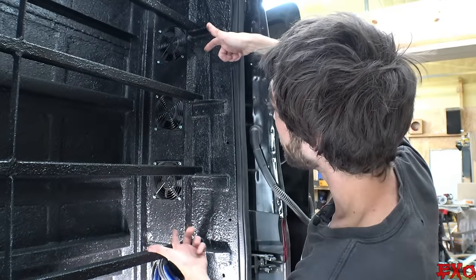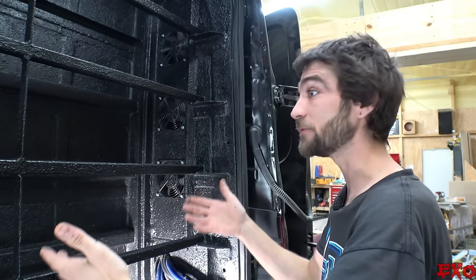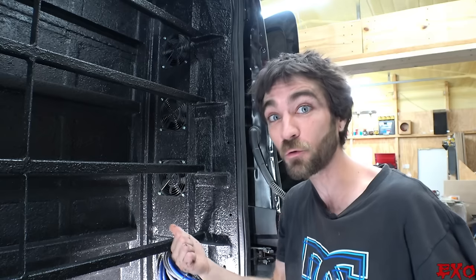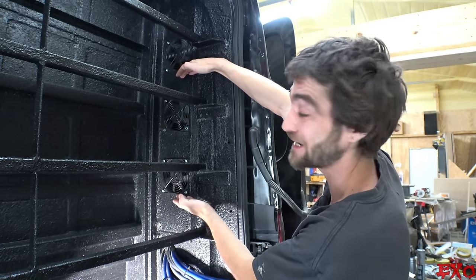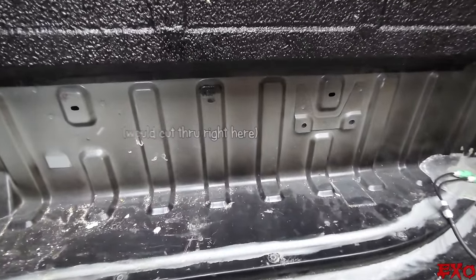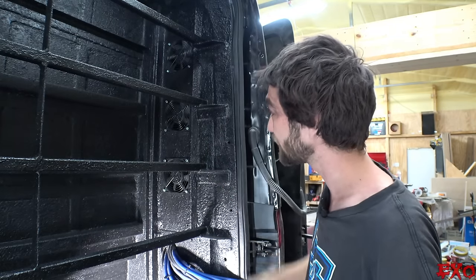With the flow reversed, like how some suggested to flip them, the area would then become a positive pressure environment, and in this unique case, that means the air inside could technically never be cooler than the ambient temperature already inside, because instead of drawing from a cooler source like outdoors, it would draw from behind here within itself. And in this scenario, the only access point to the outside world there would be right in front of a 400 horsepower engine exhaust. Whew, no thanks. This direction definitely works best for me.